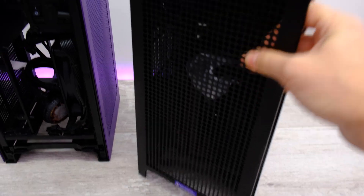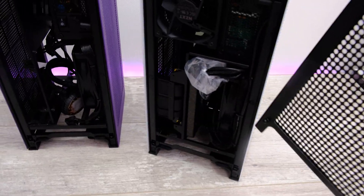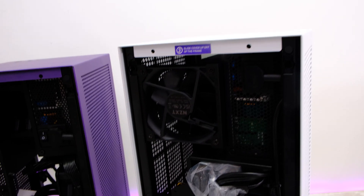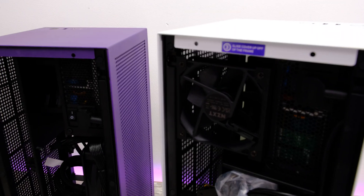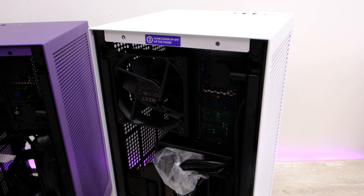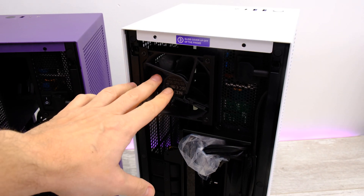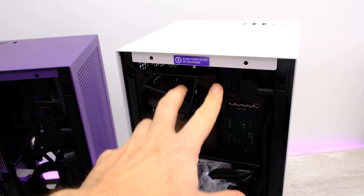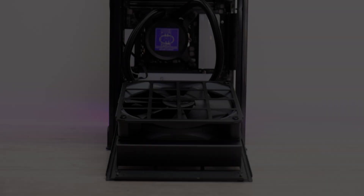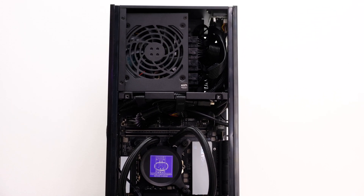How I found this was basically sky-high CPU thermals when I fired up the case again. I'd had it running pretty much constantly for the last six months acting as a home server. I dismantled it, left it for a couple of weeks, then went to test it against the NZXT H1 Version 2, and yeah, CPU thermals were sky high. The fan and pump both seemed to be working — I could hear the pump engage and the EFI showed an RPM readout for it. Another weird thing was that the coolant on one side of the tube was red hot and the other length of tube was basically ambient temperature, so clearly there was very little flow going through the loop.